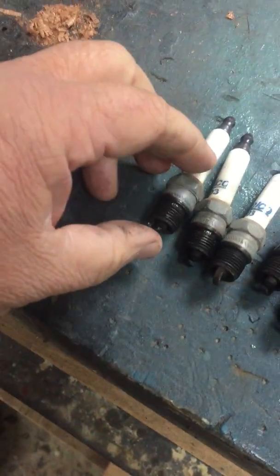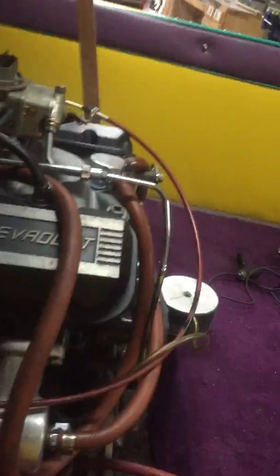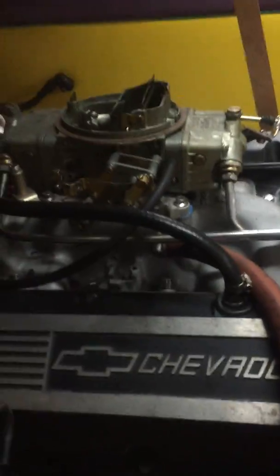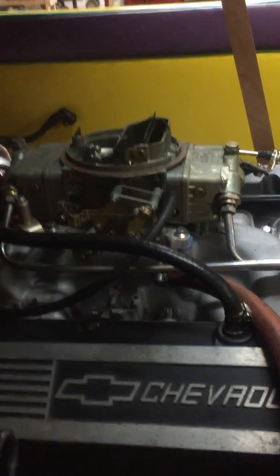This indicates that the mixture on your carburetor has been extremely rich. Rich is better than lean — you can do damage to the engine if it's too lean, but this is real rich. When I go back to the carburetor, I'll show you one of the reasons why it's rich. In order to start a cold engine you have a choke. The purpose of the choke is to start a cold engine — you can't get an explosion on a cold engine unless you have a real rich mixture.